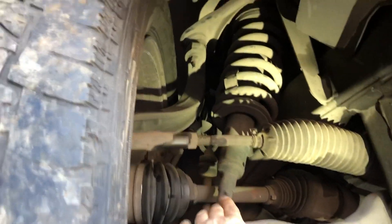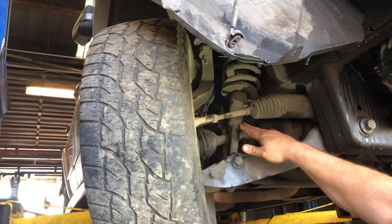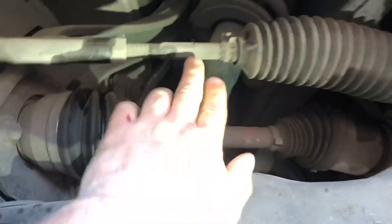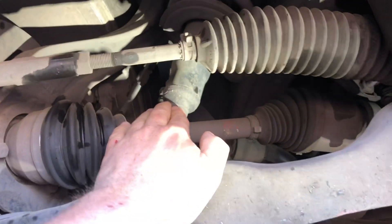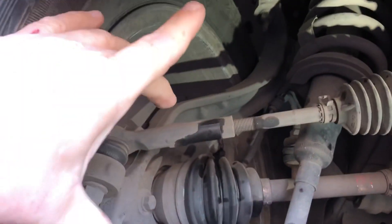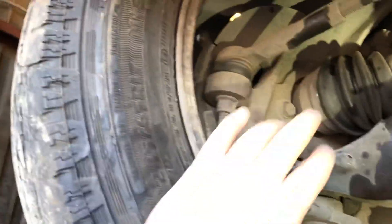Here we have a McPherson strut where the spring and the strut are one unit. On an independent front suspension, that's going to be very typical. One of the main differences is instead of having a steering gearbox, this has a steering gear rack — like your typical front-wheel drive vehicle. We've got the steering gear rack here with the tie rods. These are the boots for the steering gear rack. You've got your strut back here, your CV axle here — your 447. You've got your lower control arm and up there your upper control arm. That whole unit we would call a 510. Behind that's the rotor and the caliper. You can see this 440 drops out separately, whereas the other one you have the entire unit being replaced. This car has a crossbar, not a 477 — which would be a subframe, K-frame — but this is typically where you would see that unit.